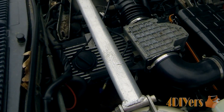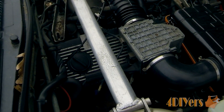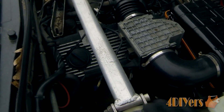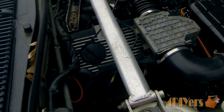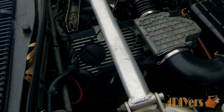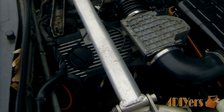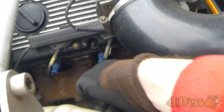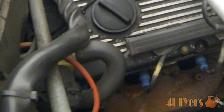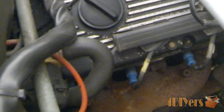To show you the difference between the other style — this is an older model vehicle, my 1984 BMW 733i, equipped with an inline six engine. So you have six spark plugs, one per cylinder. This one does have a distributor on it, which is then fed by separate wires to each spark plug. Here is the distributor up at the front with the spark plug wires coming off it, and the spark plugs down on the side of the head itself.